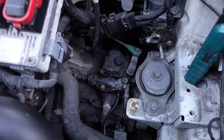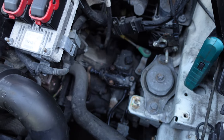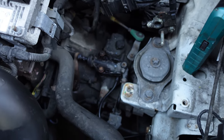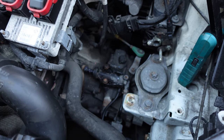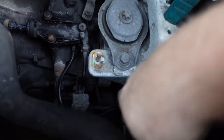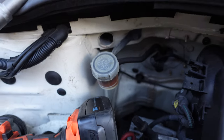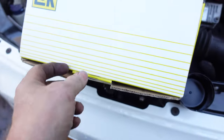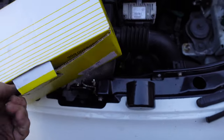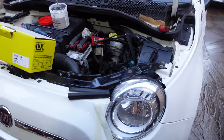Because that didn't work, what I'm going to do is change the slave cylinder. I think it's coming from the slave cylinder — it could be the release bearing, the clutch release bearing, but I think it's the slave cylinder. There's a little trick: a lot of people who want to replace their slave cylinders are worried about the join, which is underneath — the join of the two pipes. This pipe goes out and then joins to a pipe that then joins onto the master cylinder. Those are a nightmare — they always recommend if you change one to change the other. Now I've got a slave cylinder here, luckily. Let me put the camera on a tripod and I'll show you that little trick.